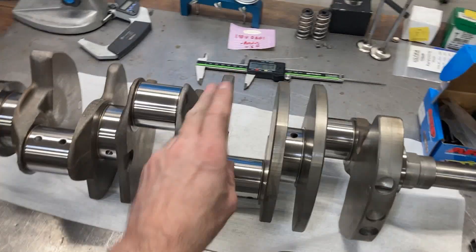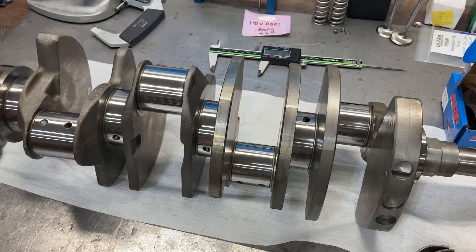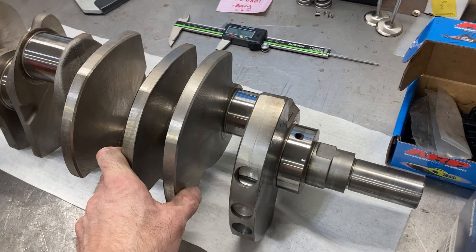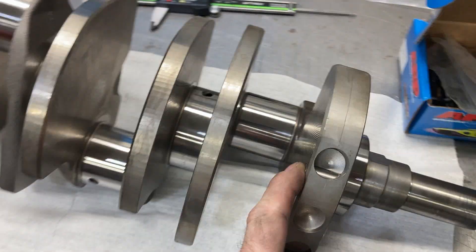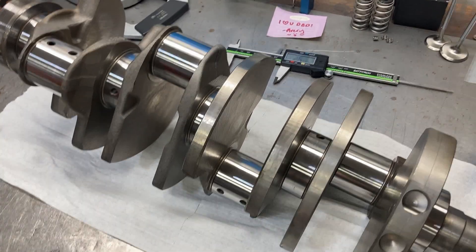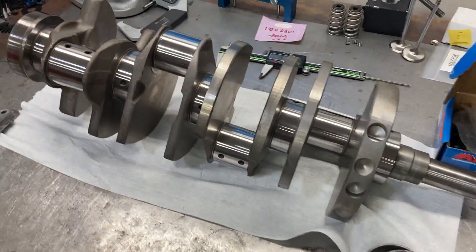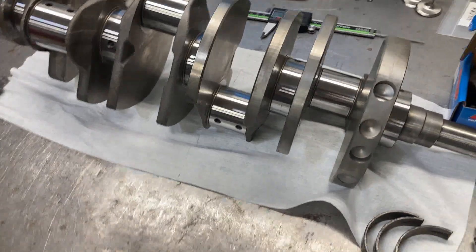Here's our crank. If you remember from when we took the engine apart, this was a nasty burnished oil mess and it cleaned up really, really nice. A couple of soaks in the hot jet wash cleaned the oil off, and then a polish on the journal set it nice. What surprised me is it took a little bit of metal to balance — I guess it was the dome pistons that added a little bit of weight. I didn't compare the weights between the old and new parts, but it needed metal on both ends. We're going to measure the front and rear main journals and make a determination on where we need to be for bearing clearances.